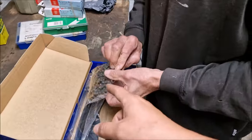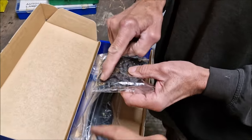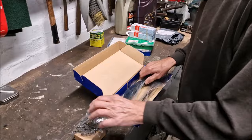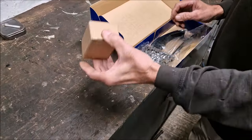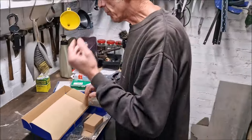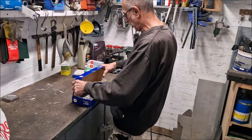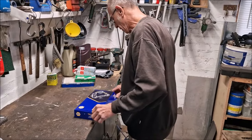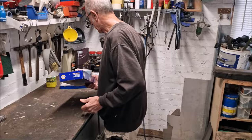And in the kit you get a chain, of course. I've got marked links, look, to time it up. Lovely. What's this? There's the guides. Okay. Chain. And what's in the box? Grease? Tensioner. Oh, a tensioner. You can get a kit with the top pulleys on, but they're not actually just pulleys, they're variable valve timing things. That brings the price up to 250 quid, that's 80-odd quid.